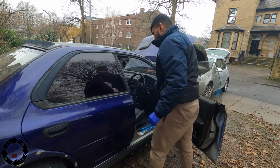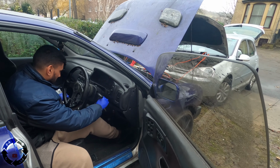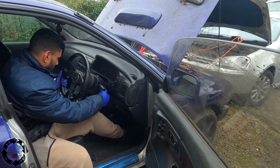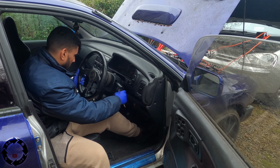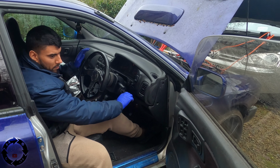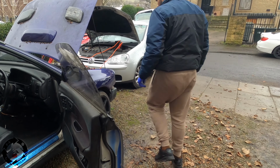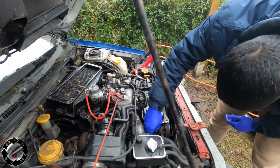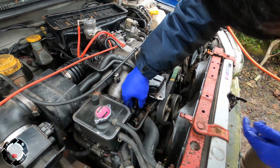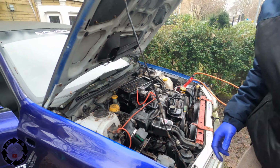This was running before, since it's been packed up. It's got a big misfire. See if all the coil. Can't see anything now. Only thing is these plugs here are kind of wet. You know, the coil pack ones, they've got like oil and stuff in them. Let's try it again.